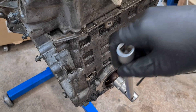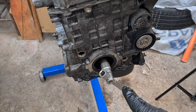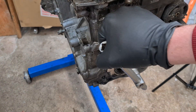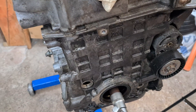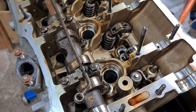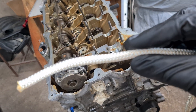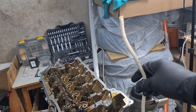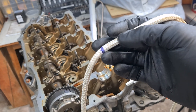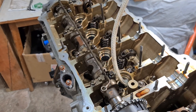Now I'm going to remember that position, and then put the first cylinder in the bottommost position by rotating it 180 degrees. Now the first piston should be totally at the bottom, and this way we can fill up the space with our rope. Here is my rope — this is just a normal nylon rope, eight millimeters wide and about one meter long. I also marked the 70 centimeter position because I've determined you need about 70 centimeters of rope inside the cylinder.